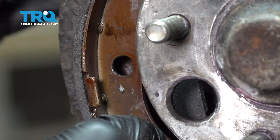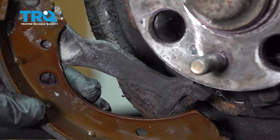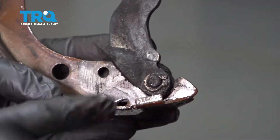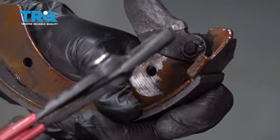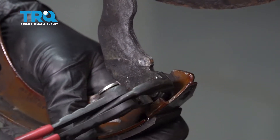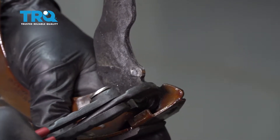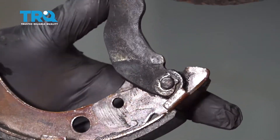Pull the pin out from the back. When you bring the shoe down and spin it around, you'll see the e-brake cable bracket assembly — you need to remove this. On the back side there should be a little lock ring. Use pliers to pinch the tabs, expanding the lock ring, and keep working until you can pry that ring off.